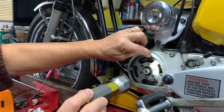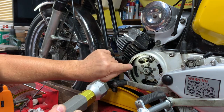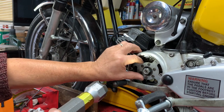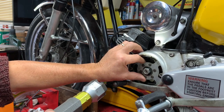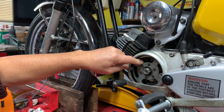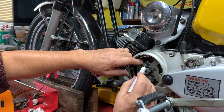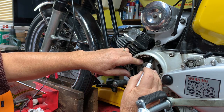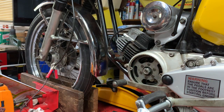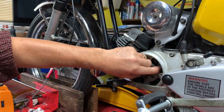I've marked a little mark on the actual crankcase. You could put a bigger mark here if you want - I didn't want to add the mark over the silver paint. Or you can make up a little pointer that comes off these screw holes. I've turned it until it stopped. Now you mark the flywheel so it's opposite - make sure you're looking dead on. Now imagine we've got a line marked on there, then you turn it the opposite way around.